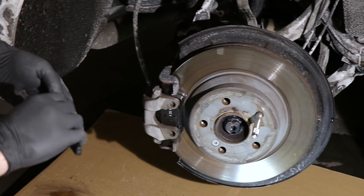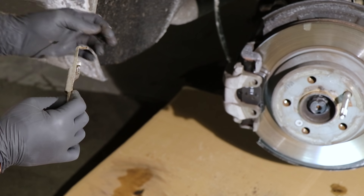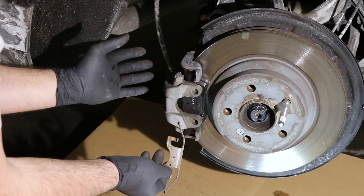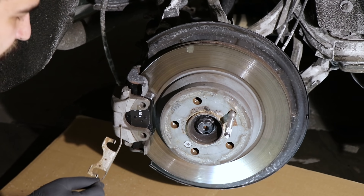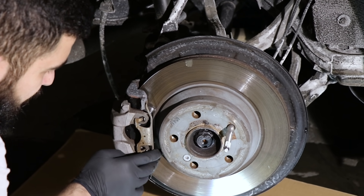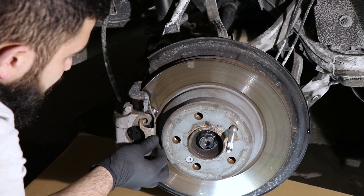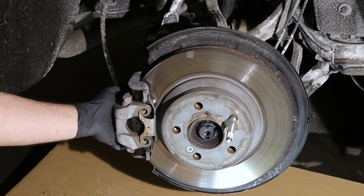All done. You can give a little bit of love to this item here too. If it were summertime I'd probably repaint everything, take it all off and make it look brand new. But since it's winter and everything's covered with salt, I'm just going to put it right back as it was. The easiest way to put this back on is to put the first pin in, let it hang, then push it back and it gets inserted by itself. Make sure you pull and push it a little bit to confirm it's securely holding the caliper in place.